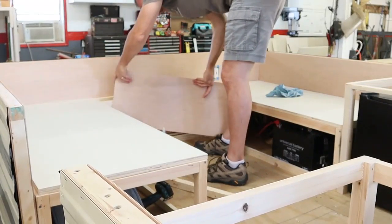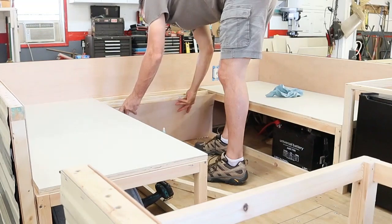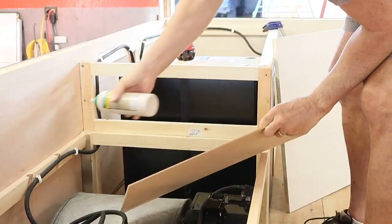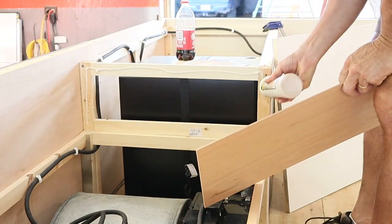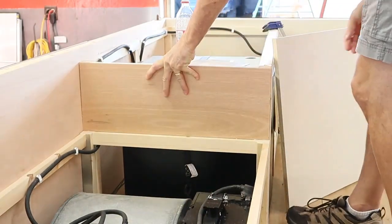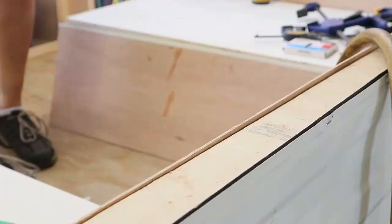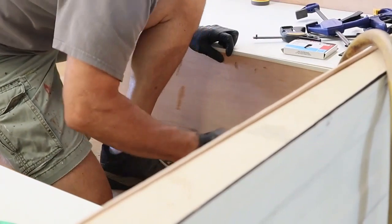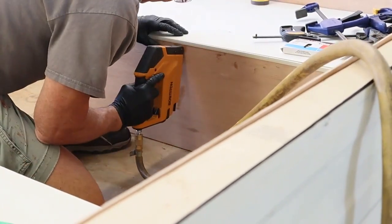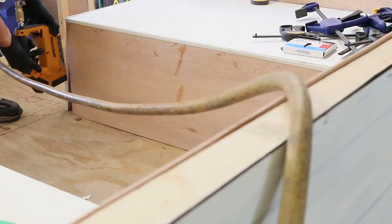This is basically piece work — you cut the little panels and you attach them to the framing. I began by gluing the panels in, but in the heat I really don't know how the glue is going to react, so I decided to change over to staples rather than wood glue. Also, any kind of adhesives or chemicals that you use inside of this pop-up camper are going to be things that you breathe whenever you go camping in this. So you can see here I decided to go ahead and start stapling panels in rather than gluing them.